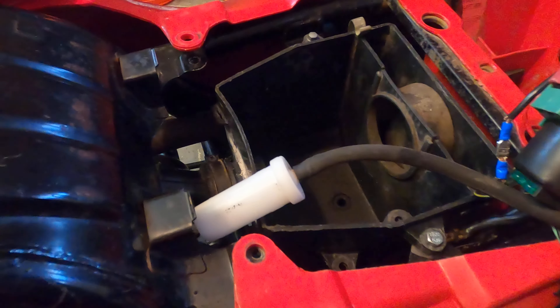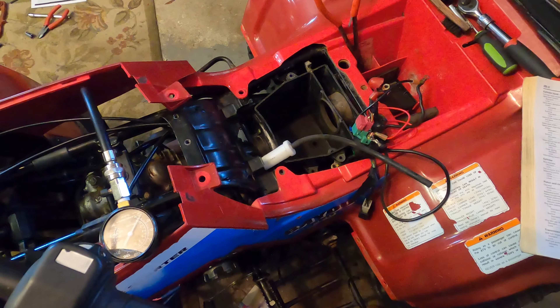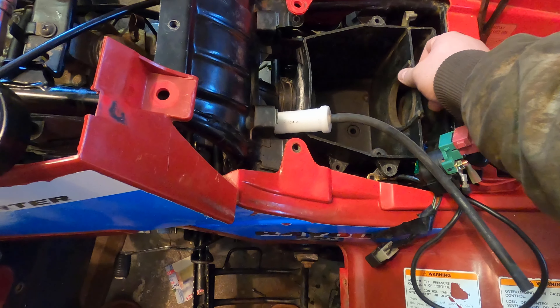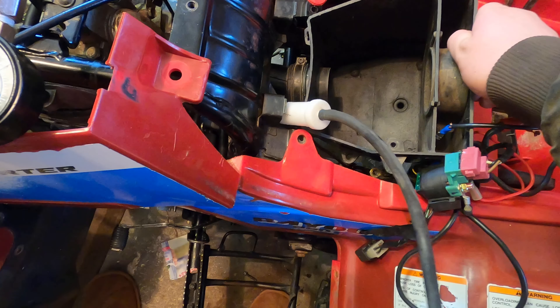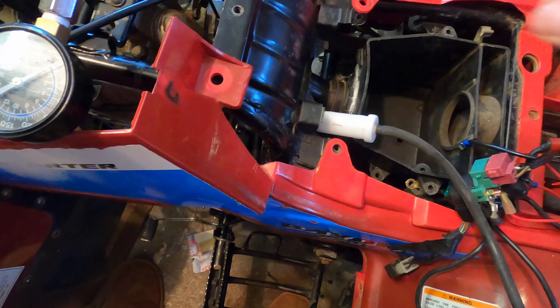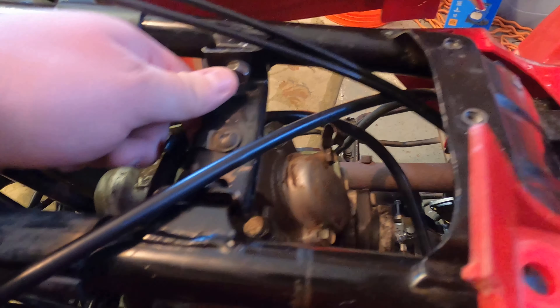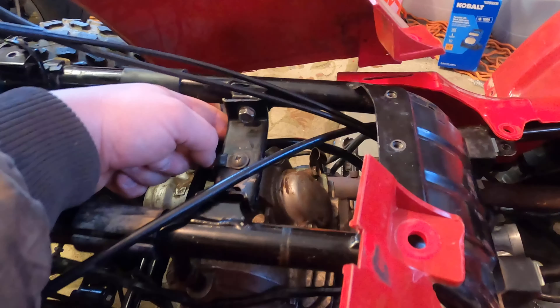With the battery out, next we're going to take the air box off along with the snorkel and the carburetor — disconnect it from the whole engine before we do anything else. These bolts should be 9 millimeters, that one probably a 10 millimeter, and the snorkel just needs a Phillips screwdriver. Pull the air box out, then get rid of the carburetor — loosen the screw on that front rubber nozzle. Next we take off this top piece, should be 12 millimeter, with one nut underneath.